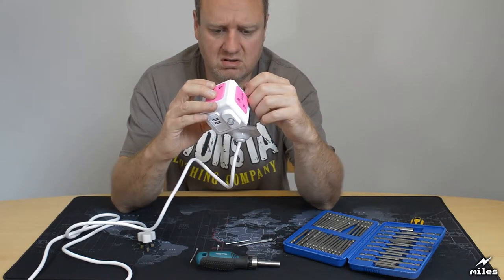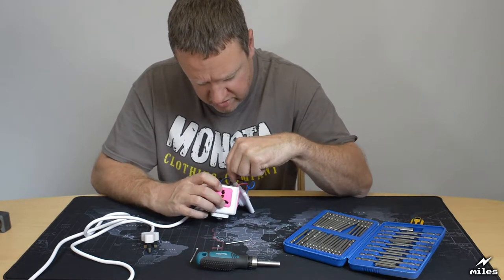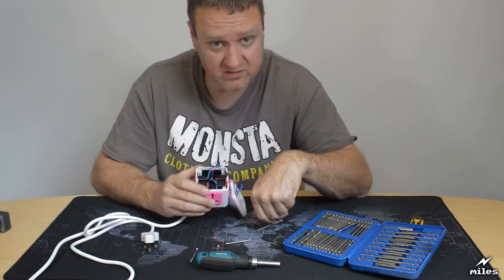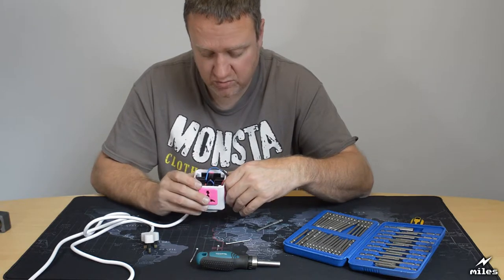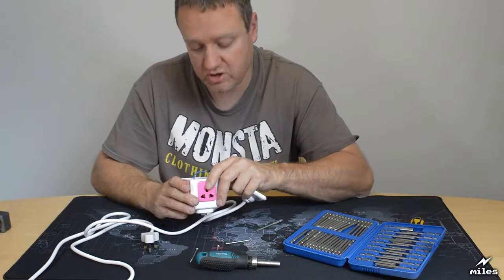that's good. Inside the sockets there are actually terminals for the earth, but there's no wire there. They've just left it off, just trying to save a bit of money. Again, they've known full well that this system wasn't earthed when they made it.